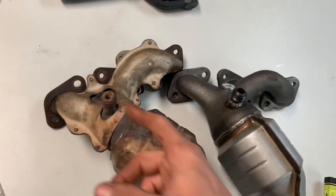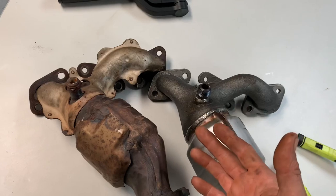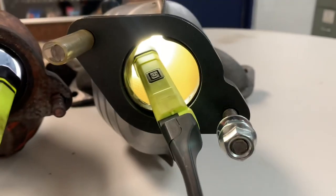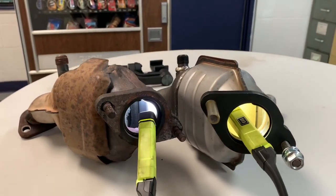You can also pass light through the converter once it's removed, but at that point you probably already have a new one. Generally these catalytic converters go defective because a misfire allows raw fuel to drop into the exhaust and ignite over time, destroying the converter and possibly the valves — though valve damage is extremely uncommon. Hopefully you feel more knowledgeable on both why and how to change this catalytic converter. Let's get going so you can get your ride back on the road.